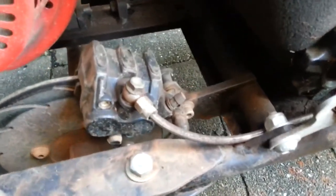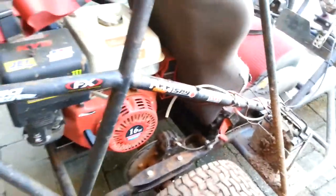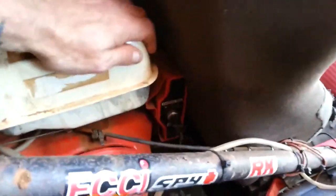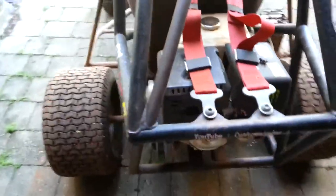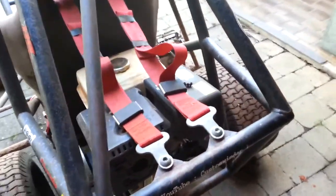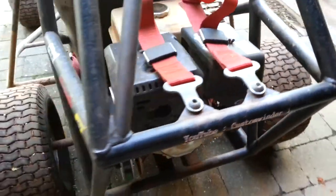Pretty basic. Battery's flat at the moment so you've got a pull starter, but she goes to the right. Going to get rid of this fuel tank — for some reason the top of it bounces around a fair bit. We'll get a better air cleaner for it too; this is a dodgy standard type one in there, going to get one of those little pod ones.